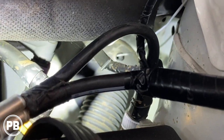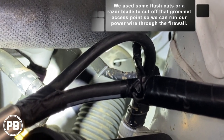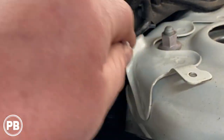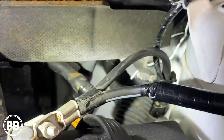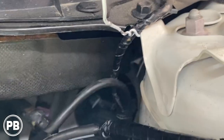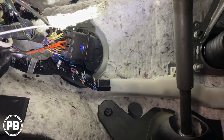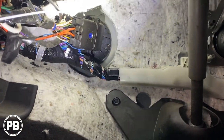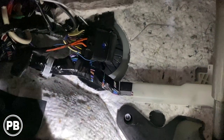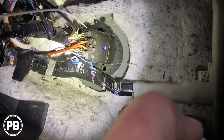We went ahead and cut that nipple off in the firewall — it's really soft rubber with flush cuts. From the inside we poked a metal hanger through, which comes out on the engine side. Now we're going inside to show you exactly where that pass-through is. There is the main firewall grommet with a little hole on top — lifting that up, there's the hole we fed our hanger through, which poked right on through the other side. A perfect little passage for our 8 gauge power wire.